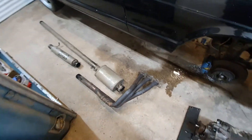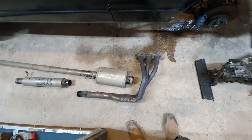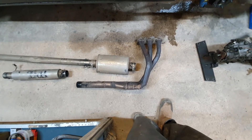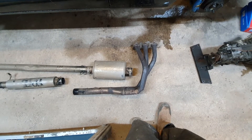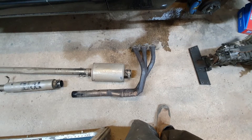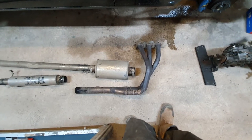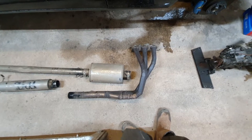So the exhaust manifolds there — I made these based on some old manifolds I had on the Essex engine before I took it out. I did some calculations; I forget the name of the chap who wrote the book, but you can calculate the optimum diameter of those primary tubes and the optimum length for performance. I think I based it around 6,900 RPM, just a fraction under the red line. Anyway, the calculations were correct at the time. These are 27-inch primary length pipes and I believe they're one and a half inch.